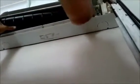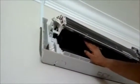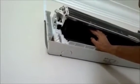This is the difficult part — getting the mounting into position. Keep moving it around until it sits right. Make sure you have the rubber damper in place. The fan can still be moved from left to right, so you'll want to center it later on. The rubber mounting is in place — now just close it up, lift the tip, and slide it down.